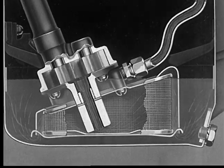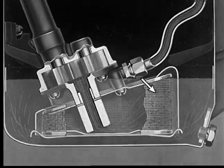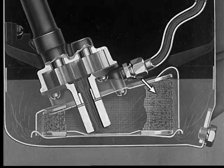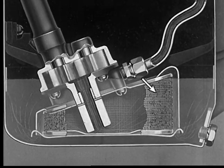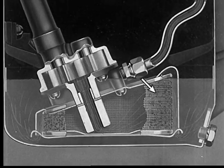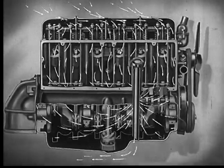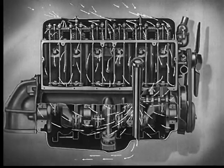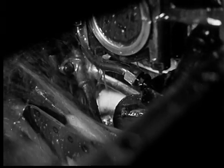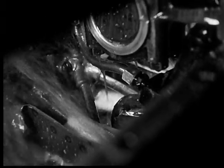Each time the oil passes through the engine, it is filtered so that dirt and impurities can be kept from the polished surfaces. The oil is cooled in the bottom of the engine and allowed to rest in the oil pan. Efficient crankcase ventilation removes hot, corrosive gases so they cannot contaminate the pure oil. A tremendous stream of cooling, cushioning lubricant is pumped through the engine.